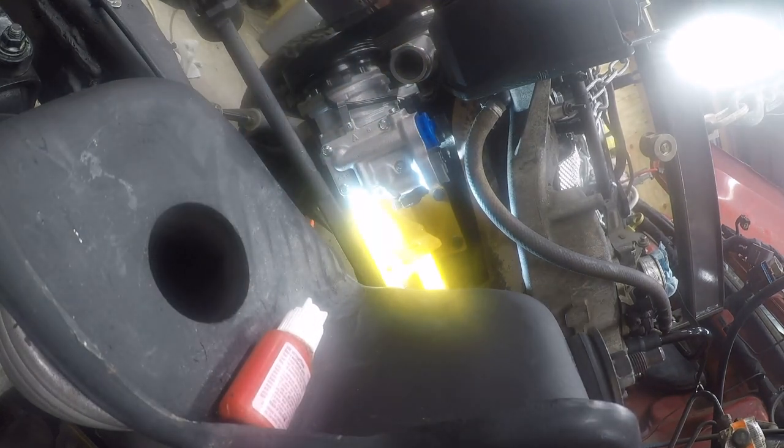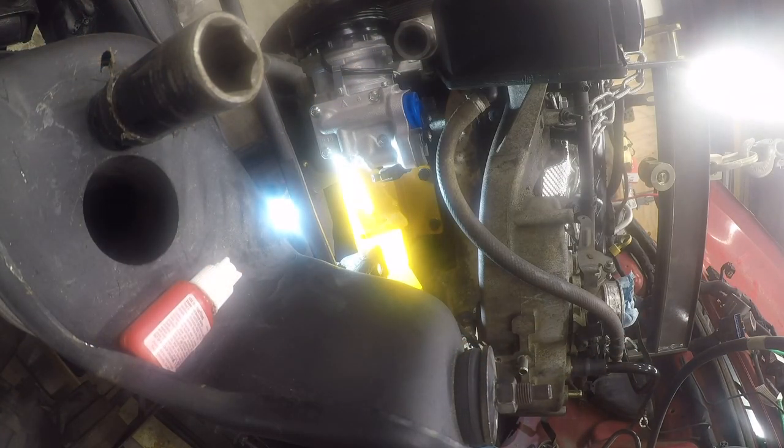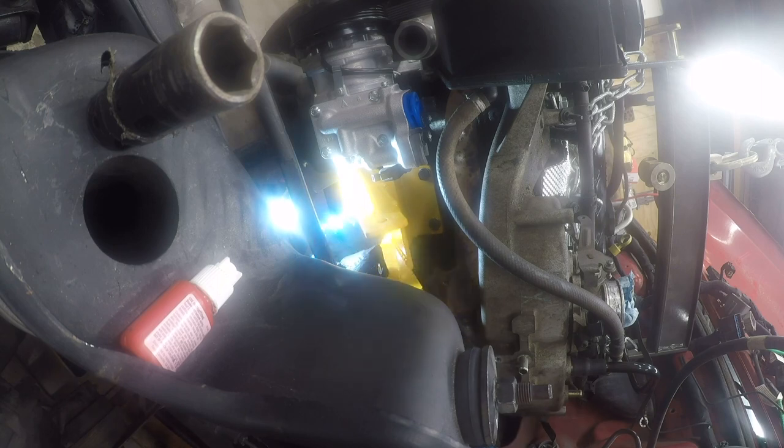So I've got to figure out the sizes and torques. I'll be right back. Okay, so these are 40 foot-pounds is the torque. That's what we used last time. And apparently I've got the wrong torque wrench because I don't have the right one. There we go. So, we'll get to see if this is a pain in the ass or not. I thought that was a 17 millimeter. It is not. But that is. So, we'll go ahead and do that one while we're down here.